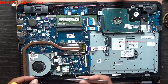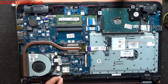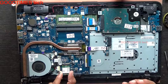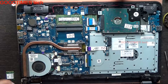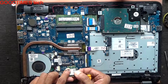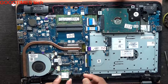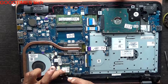For that, just gently remove this antenna cable here. Now unscrew this, just pull it back — don't push it upwards, just pull it. If your Wi-Fi is getting disconnected, you can try cleaning these terminals or these connecting pads, the PCB connecting pads. You can see the copper tracks — clean them, and after cleaning them just insert them back in this way and fasten the screw.